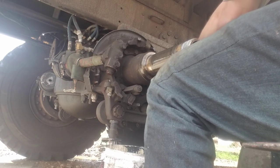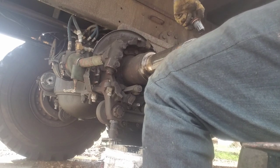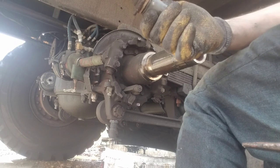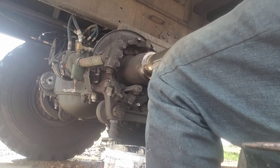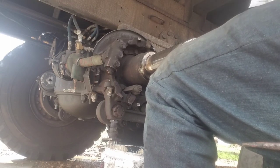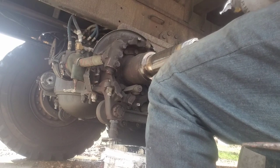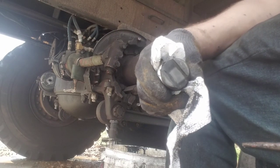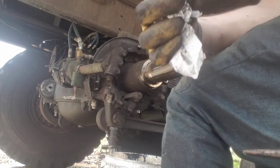The little cover has an outside lip so you ain't gotta go digging down in there. Pop it out and you can see some of that oil, grease, and everything else. It's pretty stiff and corroded. One thing you want to make sure of is to look at the bottom of the adjusters on both sides. Take them apart to clean them out or add grease, and make sure it has a mark on it — the wedge mark means your wedge is most likely working. If it's not, it'll be dull.